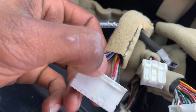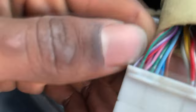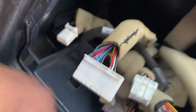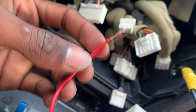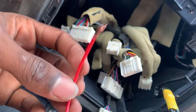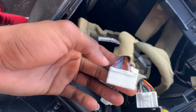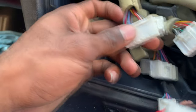It'll have a bunch on the left side, a gap you could probably fit your finger through, and then some more wires. The wire we're looking for is going to be the red and green wire, which is the parking brake wire. If you want, you can cut and reground all of your red and green wires into one negative wire — that's going to bypass every parking brake aspect of your car. All I want to do is be able to play movies on my screen without the parking brake being engaged, and this is exactly the wire you have to cut and ground.